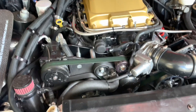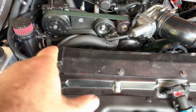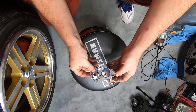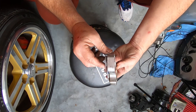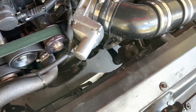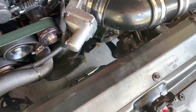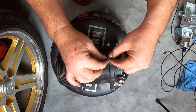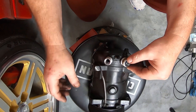We're gonna be pulling the water pump off as well because some of the bracketry bolts are kind of behind that. We need to pull it off anyway because this system has spacers behind the water pump and the heads to push the water pump out so the pulley aligns with that outside eight rib pulley set. We're also pulling the alternator, the high mount AC compressor - the Sanden 508 - plus the upper pulley and crank balancer. We've got new stuff including an ATI super damper with a bolt-on ring.